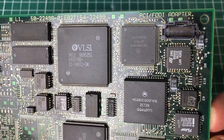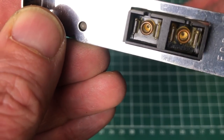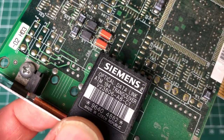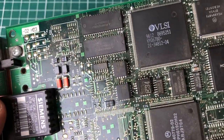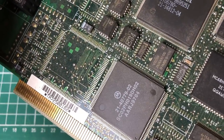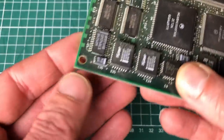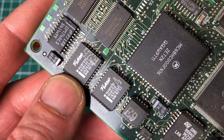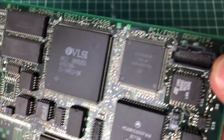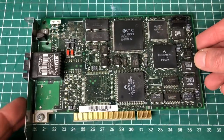We also have this little card here which is a PCI FDDI adapter with a Siemens connector — a Fiber Distributed Data Interface used for local area networks using optical fiber cable as the underlying physical medium, not something you come across every day. In this case though we're going to be using the standard 100 megabit Ethernet card which is embedded on the main board and exposed via that expansion card.